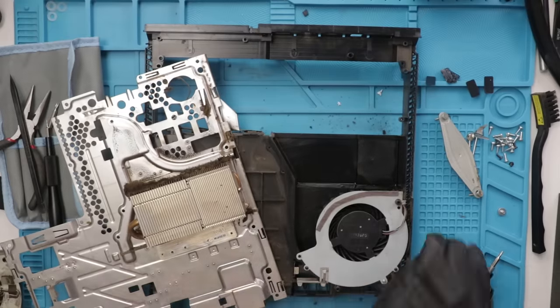Number five turns on, but the blue LED is broken and the HDMI is broken — it has the white light of death. I'm going to get this one taken apart and check out the HDMI system. We've got some new thermal paste here, so somebody has already tried to fix this one. You can see the whole entire middle of the HDMI port is gone — that's what we need to fix. There are also a few little components that are missing, so I'll need to replace those. Let's get this port out, get a new one in, and then get those replaced.